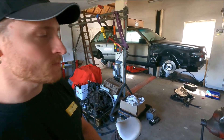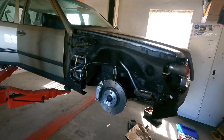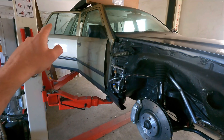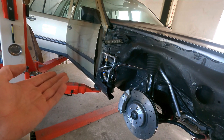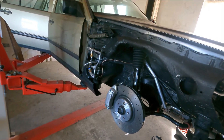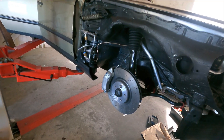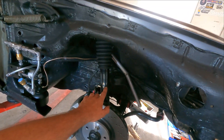So what is the case with this car about the suspension? Normally you have SLS suspension - self-leveling suspension in the back in a station wagon that is standard. When you load up the car, it will raise it up to the level you want. That is a level you can adjust a little bit, so you can have a lower or higher adjustment. I have in the front also self-leveling suspension.